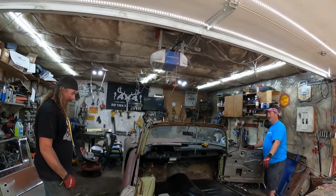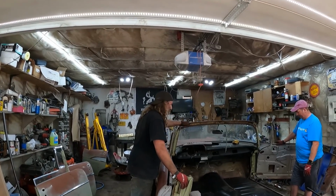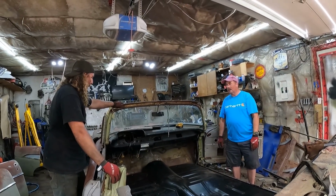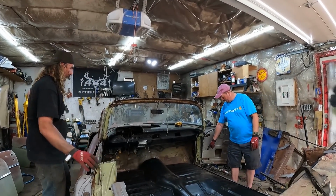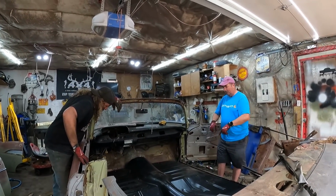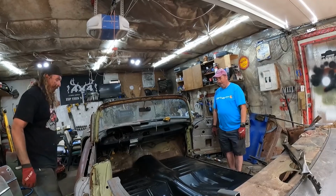When you had it welded with the torsion, it wouldn't happen, but now you've removed all that. Well, this would be the same spot. I'll just re-weld this, and I'll just jack up, put it on. Well, is there anything that you can jack up here? Because that would do it. It's bent right to this thing right here. If you lift that up, then this will go ahead, and then this will all come up. So it's not even that bad. I'll just pull the door post in, and we'll lift it and latch it.